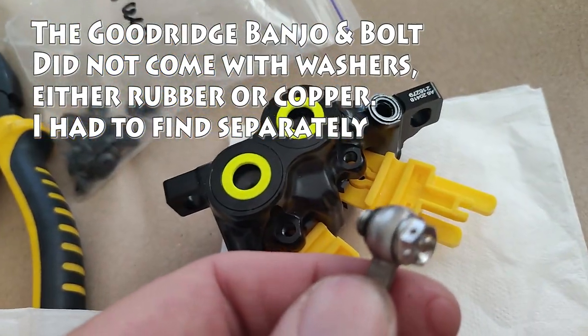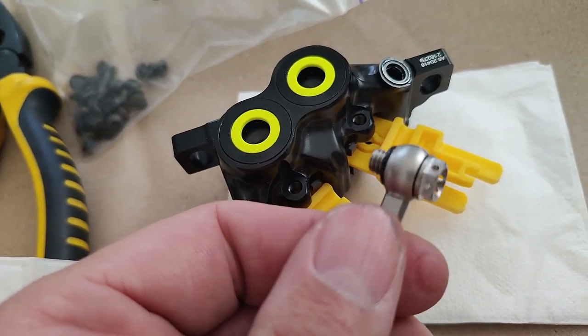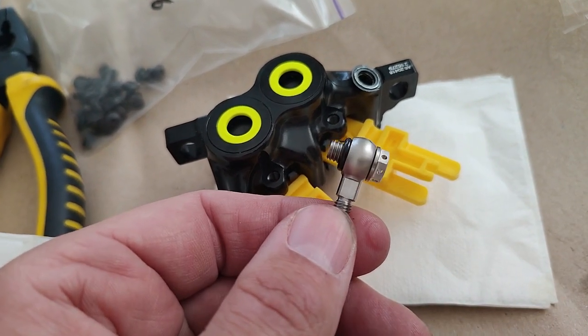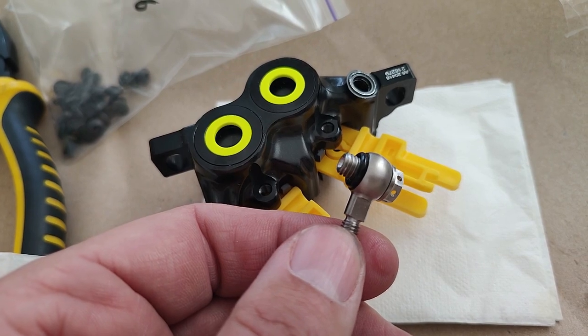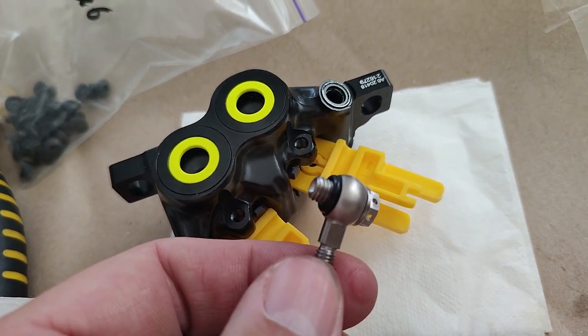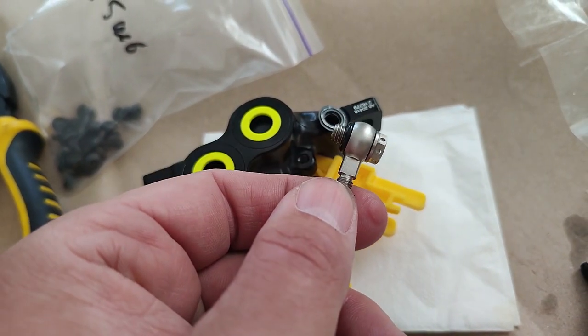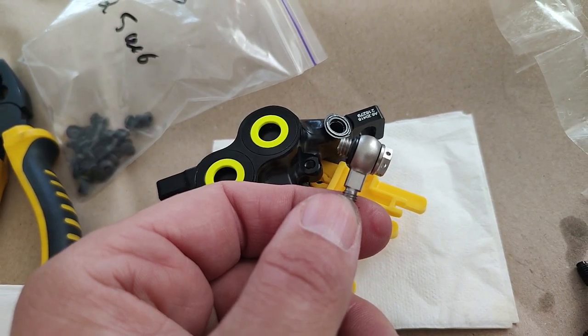It's maybe a trade-off. But the good thing is the tires that I use here, the Ulip, are available in 90 and 100. And I saw with PMTs, those are also available in 90 and 100. So most of the good tire brands, you can get either size. So you definitely want to get the narrower tires. That's the first point about clearing the caliper and clearing the Banjo.